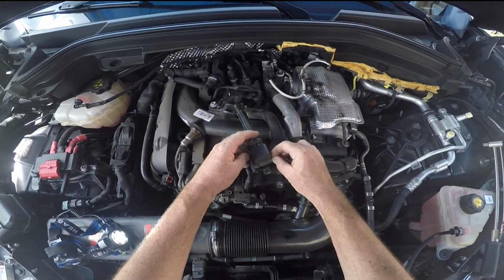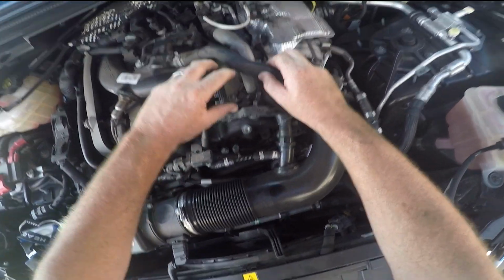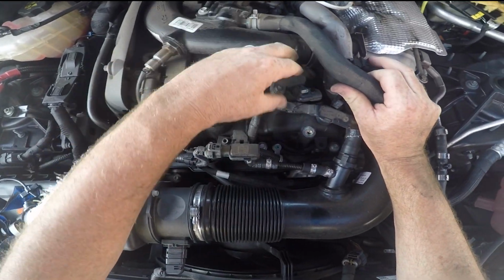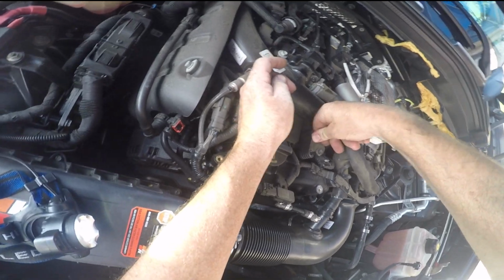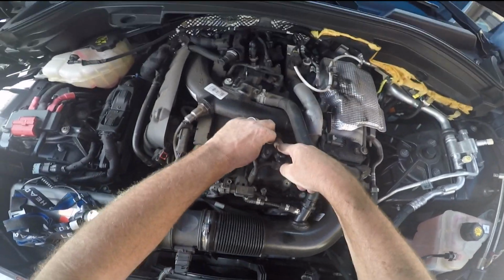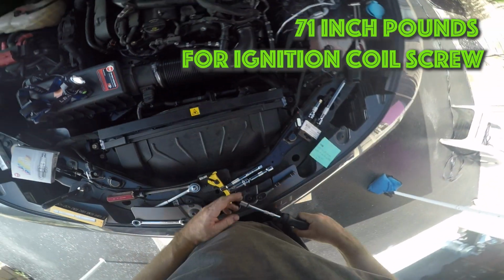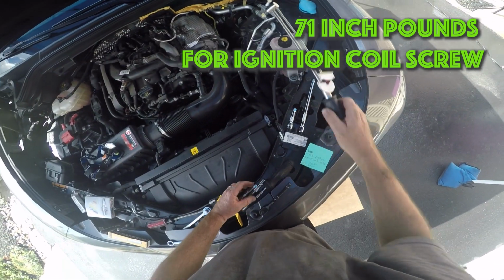So the spark plug is properly seated and torqued to the 15-pound factory spec, and now you just need to reinstall the coil pack. So I'm going to very carefully bend that rubber boot so it gets back into the hole there, and just push it down with some pressure, and you'll feel it slide on to the spark plug. And once you tighten the bolt, that'll create a good seal there. I'm going to hand tighten that 10mm bolt, go back to my ratcheting screwdriver and tighten that up. There is a specific pressure to tighten these bolts, but I found once they're snug, that was good enough.